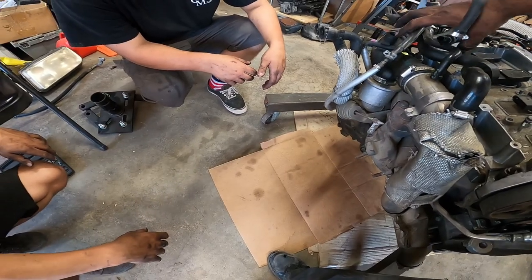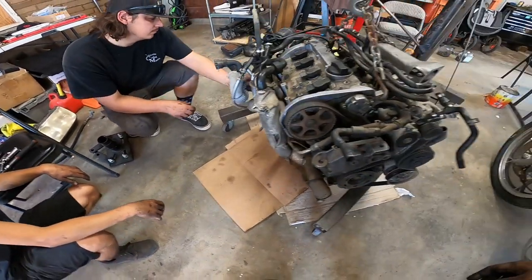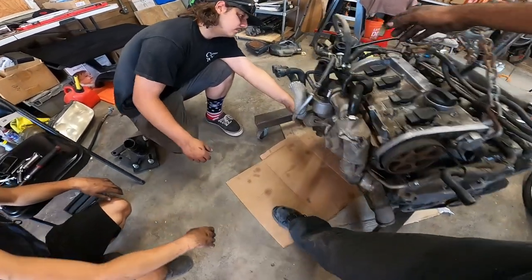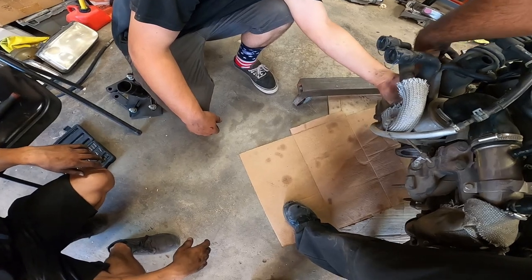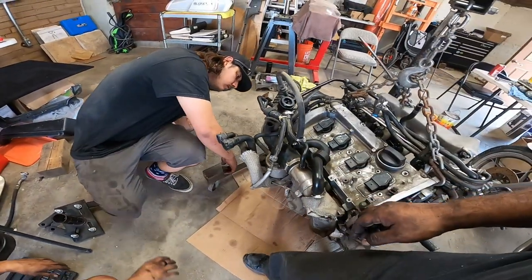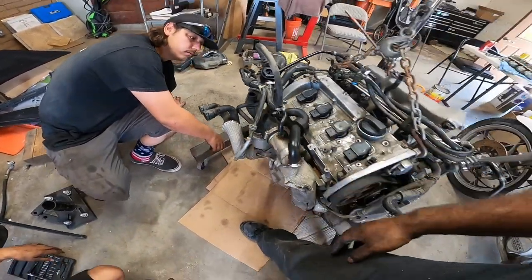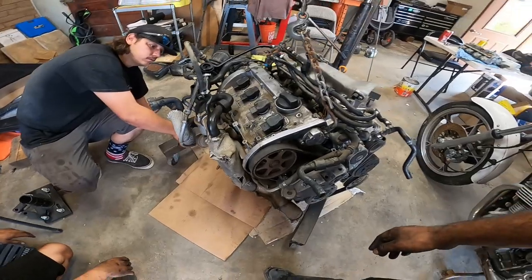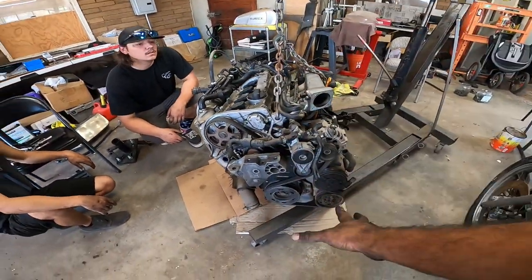So this piece can be here, all one piece, and this just bolts right off, okay? Same with this one. This is part of the turbo. It's just a little clip right here, or you can take it off the front. There's a bolt on the front of the turbo, a little 5mm Allen. And this all comes off as one piece. Okay. And then once that's all disconnected from over there, we're going to work our way to the accessory bracket